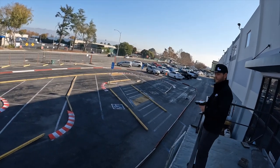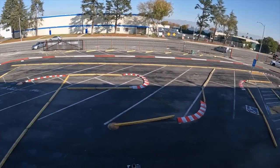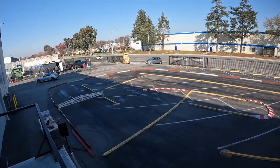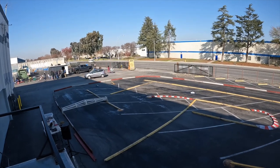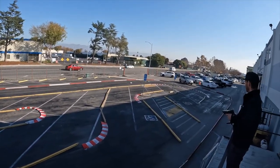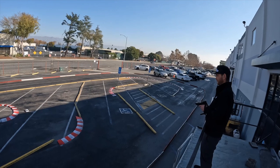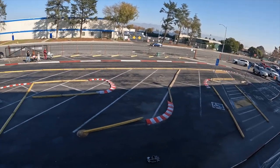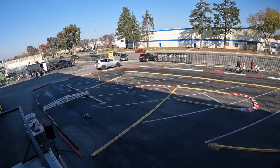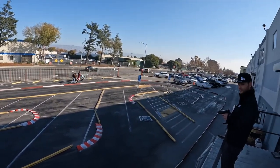This thing slips and slides. The rubber is incredibly hard. If you want to soften up these tires, you can put them in baggies with silicone oil — shock oil or WD-40 silicone (the yellow can) — and leave them in heat for a week. They might bloom though. Another option: scuff them, wash them with laundry soap, then apply a modifier like Mighty Gripper black. Sauce them, leave until fully dry in a hot area, and repeat multiple times.